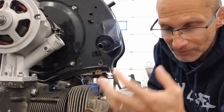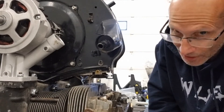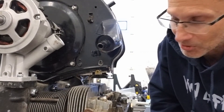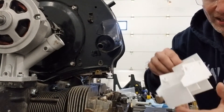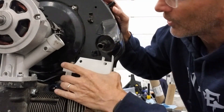The way these will line up when it opens up — I have a heat gun under here and I'm going to turn it on just a minute. You'll be able to watch these flaps move as the thermostat expands, simulating essentially the warm-up of the engine with a heat gun pointed at the thermostat down below. You'll see the angles — the reason I did this test was to make sure the design is correct.